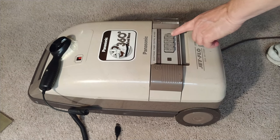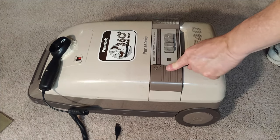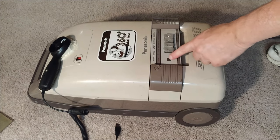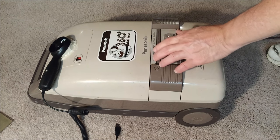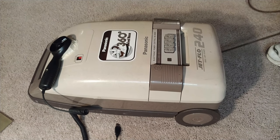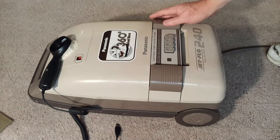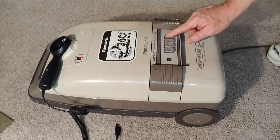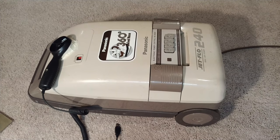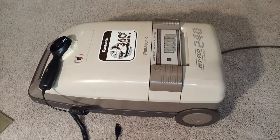One of the first things I noticed was that even though the power buttons work and the motor does spin, the foot switch doesn't have any effect — so there's a mechanical problem inside somewhere. The cord retract does work, which is surprising since that usually goes bad. I also want you to pay particular attention to the motor wind down — here is a textbook example of no grease in the motor bearings at all.